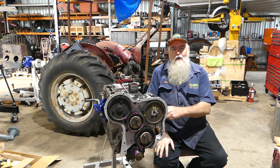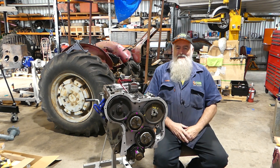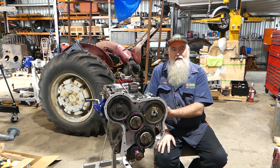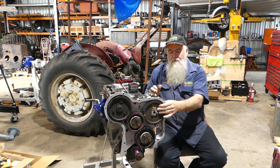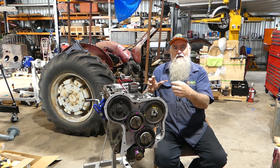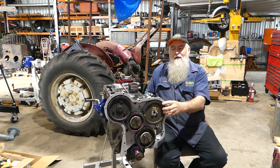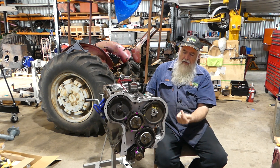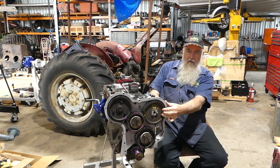I had to take a photo of my mark here. I turned this engine over yesterday and made sure it lined up - I think the photo shows it's lined up. Now if it's not lined up, what can you do? Well, if you've already checked where that circlip is - where the flat on the circlip is - so you know your pump's timed right, just loosen the three bolts that hold the injection pump on and turn the pump housing a little bit. The rotor in the pump will stay put and you turn the pump until it lines up. Because there is a little bit of backlash, it certainly doesn't hurt to take it before top dead centre, come up again, or hold this gear in the direction of rotation to ensure no backlash.